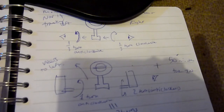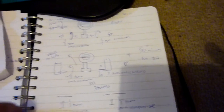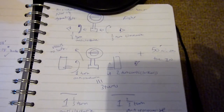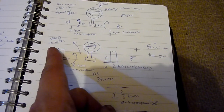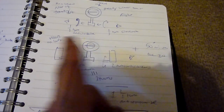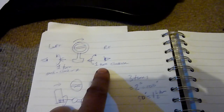What I did earlier — effectively three turns total — the pendulum swung too far the other way. Instead of 50 minutes toe-in it became 50 minutes toe-out. So three turns is too much; one and a half turns is what I need in total to bring it back to dead center. What did work was it stopped veering to the left, so that part was fixed by opening the right wheel more than the left.